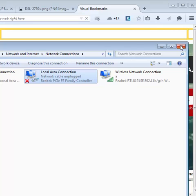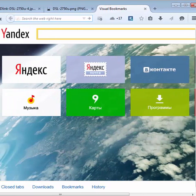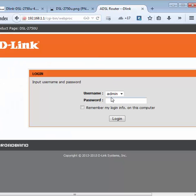Then close the network settings. Here I am connecting via wireless LAN, so it is not showing the wired port as active — we can close this. Then type 192.168.1.1 in your browser. The default username is admin and the default password is also admin.